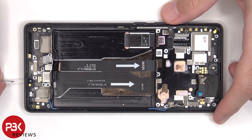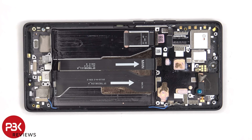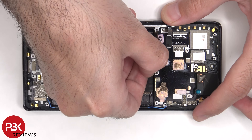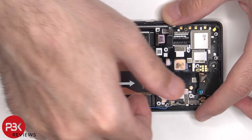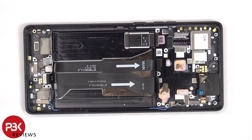For anyone worried about puncturing the microphone filter: both the microphone and the filter are seated above the hole, so if you use your SIM ejector tool on the wrong hole, you won't have to worry since neither of those will get damaged. There are also two more liquid damage indicator stickers on the bottom — one under the charger port on the frame, and the other under the SIM reader. Once these flex cables have been peeled back, we have a better look at the copper vapor chamber which runs underneath the battery as well as the motherboard.